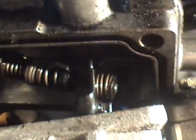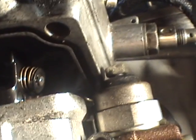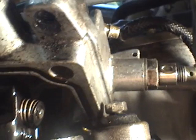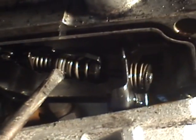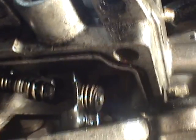So this is the inside of the pump, and this is what the governor mod is. You can see there's different springs there, and there's three flat washers. I've actually put stainless steel washers in there so it doesn't react to the biodiesel.